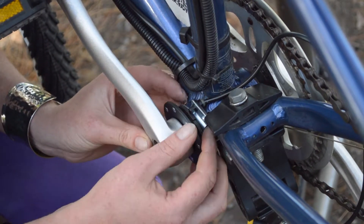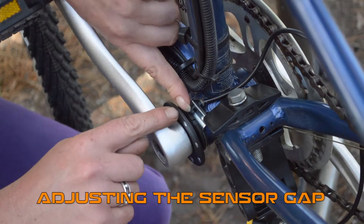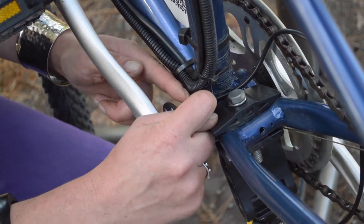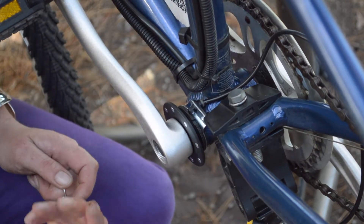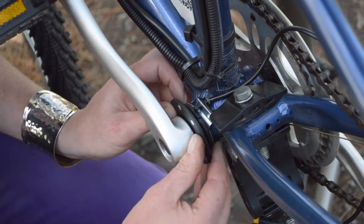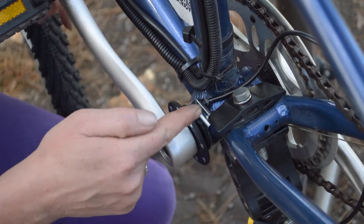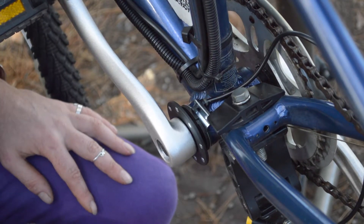In some cases you may find that the gap between the sensor and the magnets is a little too great. You can tap on this metal part with a screwdriver gently and bend it out a little bit towards the magnets. Or if the opposite is true — that your disc is too close and rubbing depending on your setup — then do tap that sensor away a little bit by putting a screwdriver and a bit of a hammer to it. But essentially that is job done.